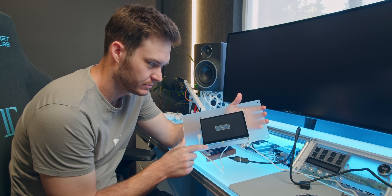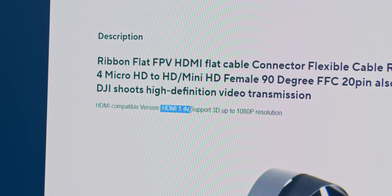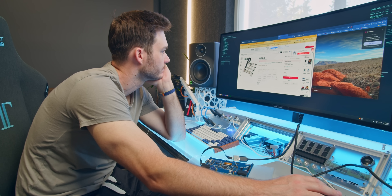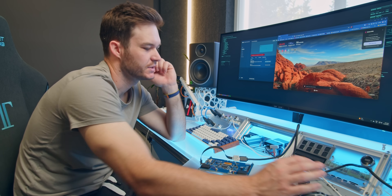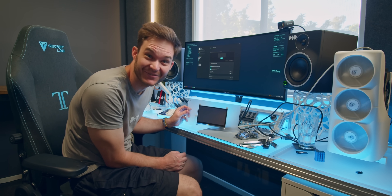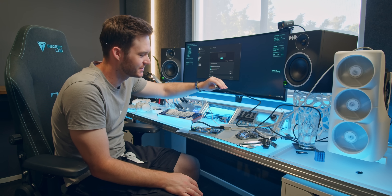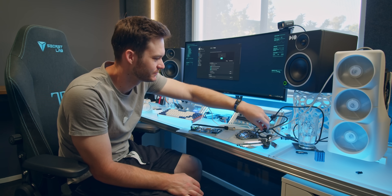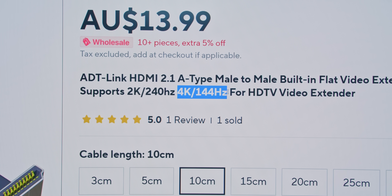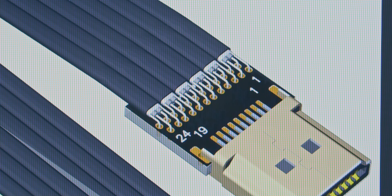The too-good-to-be-true catch is the specific modular tip model is only HDMI version 1.4, which supports resolutions up to 1080p — fine for my little screen here. Using a different HDMI cable from the graphics card, it found the new screen. So if you're extending a cable, it probably also needs to be an HDMI 1.4 cable. If you need 4K support up to 144Hz, I have seen HDMI 2.1 options, but you can't remove the tips — they're soldered onto the circuit board.